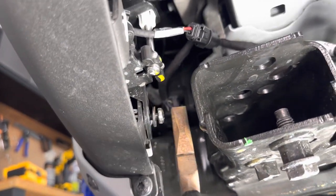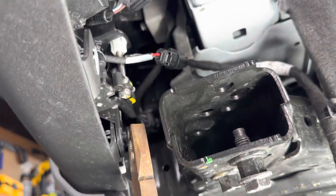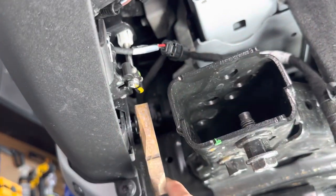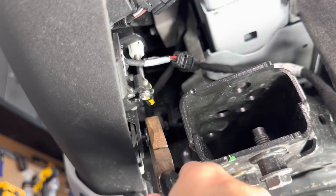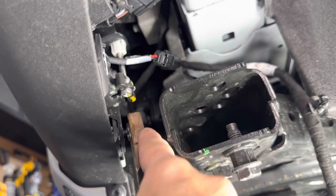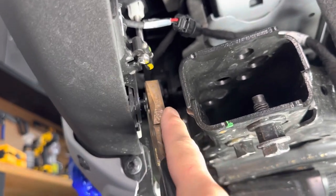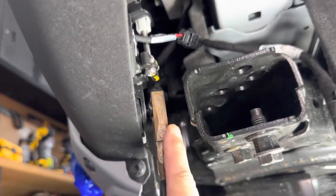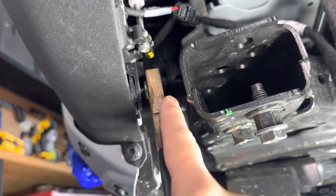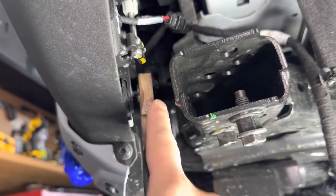There's so little headroom in here, I found once I got it backed out enough, it's actually a lot easier to just go ahead and use some kind of pliers, grab the head and back this bolt out, because the clearance between this bumper is very limiting, especially the further the screw comes out, you get less and less headroom between the angle of the wrench and the bumper. So it's just very frustrating. This is probably one of the harder disassemblies I've done on the Ford vehicle here.